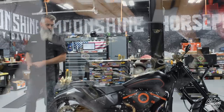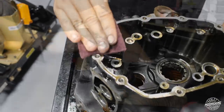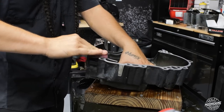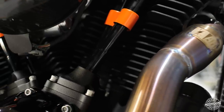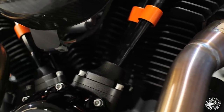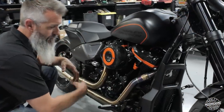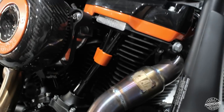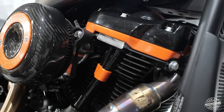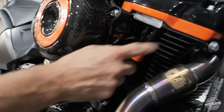Just like all of our big builds, this guy starts off as a case bore. It gets our big case bore, which requires the four-and-a-half inch monster cylinders we make. These are our cylinders. On this one, they're not just the monsters — this is a pair of our CNC Game Changer MHP cylinders. These are actually CNC cylinders. We are testing out some black anodized — we want to see how they hold up. They look beautiful. The heads are painted, they're completely blacked out.